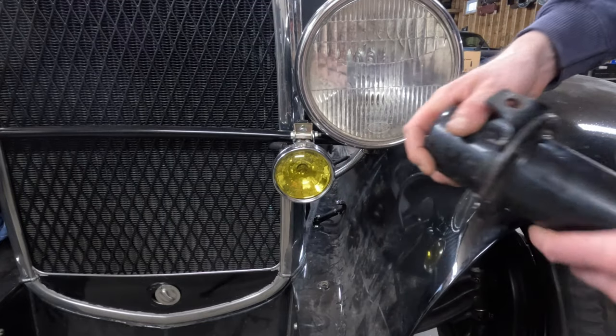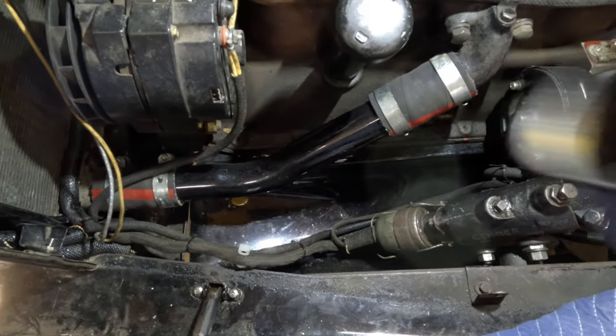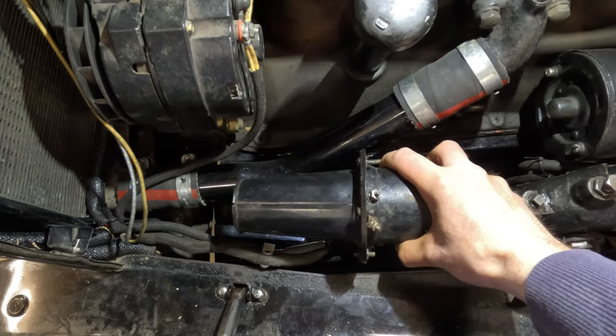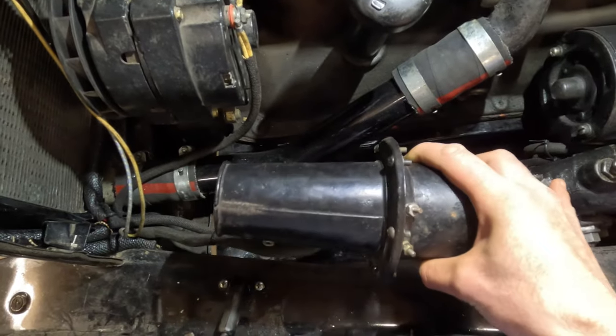Mounting this underneath the hood will actually improve the aesthetics of the front end. Here's the plan — I'm going to mount the horn underneath the hood right in this general vicinity. This should leave enough room to get to the petcock to drain the coolant, the dipstick to check the oil, the headlight switch, and the fill plug on the steering box. In keeping with my plan for this car, I want to modify it as little as possible — drilling as few holes as possible, ideally none. My plan is to use the rear bolt for the front shock mount right here to attach a bracket to the frame without drilling any additional holes.